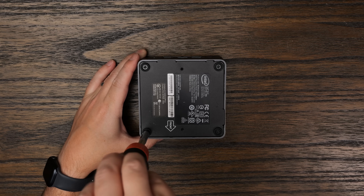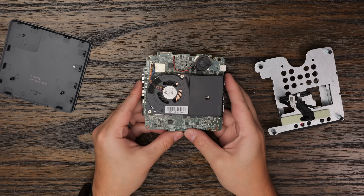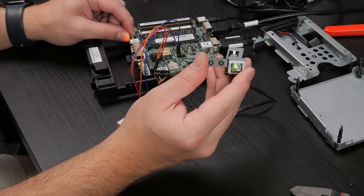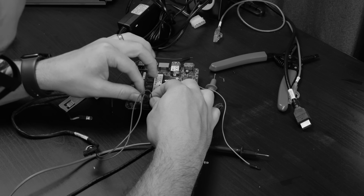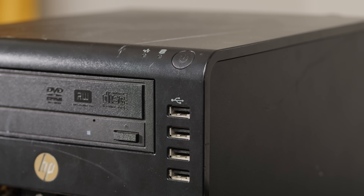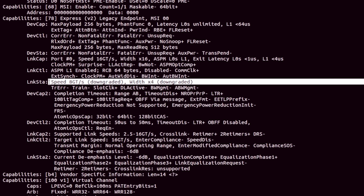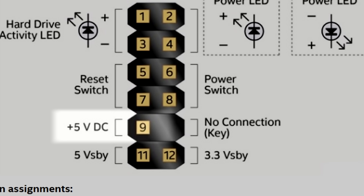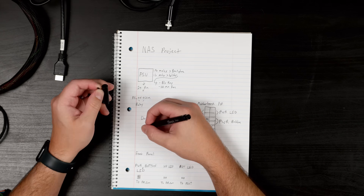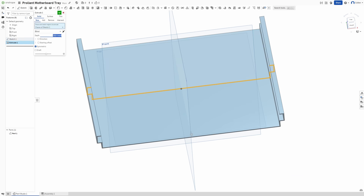While the replacement board was on its way, I kept working with a 7th gen NUC. It doesn't have the B-key or E-key M.2 slots, but it still has an x4 NVMe slot, a mostly identical front panel header, and a very similar physical layout. This let me continue testing, and I found that both the power button and the LEDs all worked as expected. I also confirmed that plugging in an M.2 to PCIe adapter and hooking up an RTX 3050 showed up with no issues in LSPCI. By that time a 5V relay arrived in the mail, and using the 5V pin on the front panel header, I was able to perfectly sync up the power supply with the NUC board.